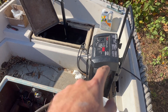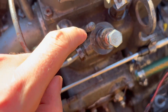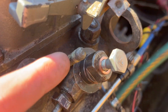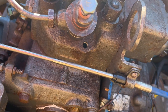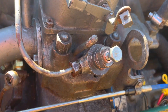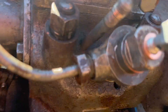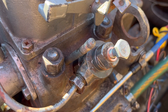We got a lot going on here. We got a battery tender, some CLR in a bucket running through the engine, and we have one broken stud. As I was putting the injector back in, after going to town, I over-torqued the bolts going to these studs. I broke this stud basically right about here, broke everything off thereafter. I'm thinking I might have enough thread to put it back in. I also have a replacement stud from a hardware store — just a long bolt. I had sprayed brake clean up above, and it settled in this area. In a rush to judgment I made a poor decision, which resulted in the broken stud.